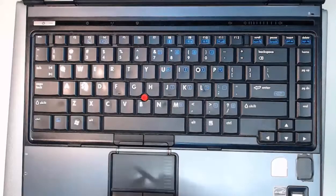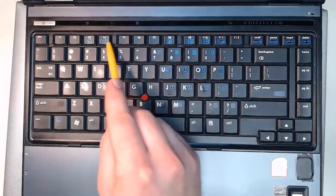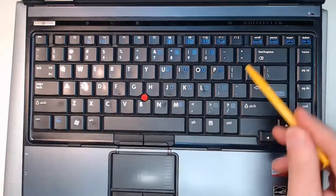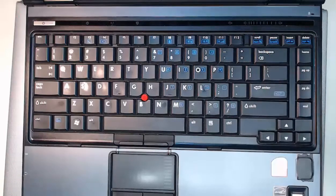Now that those screws have been loosened, I can turn my laptop back over and we'll take a look at the keyboard. With those screws loosened, we've got our keyboard available here. We're going to take a look at the 4 sliding locking tabs, and we're going to have to unlock those by sliding them back. Right now they're being held by that frame. So we'll zoom in and take a look at those 4 locking tabs.